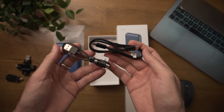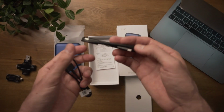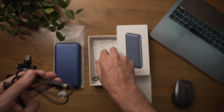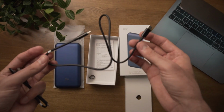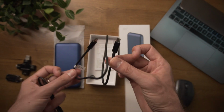So if you were going to carry the ZMI in a backpack or something like that as a daily carry, it's just extra functionality there. It can also charge itself at 45 watts. That's a really fast charge rate for a 25,000 mAh pack. If you had a big enough wall charger, you could charge this from dead to full in about 3.5 hours. And finally, for functionality, you can discharge this from all 3 ports at once. So yeah, you could, in theory, charge 3 devices at once. And given the 65 watt output, yeah, you could charge 3 phones without horrible results.